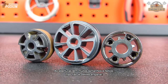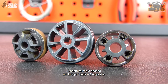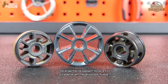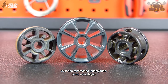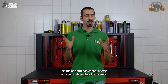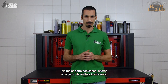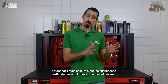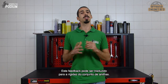The ports come in many shapes and sizes, but don't be fooled — a port isn't just a hole in which the oil flows. Engineers spend countless hours working on fluid dynamics to make sure the ports provide the best oil flow while reducing any unwanted phenomena such as cavitation. In most cases, changing the shimstack setup will provide the desired results. The most common feedback people hear about suspensions is that they are either too stiff or too soft, which can be translated to the stiffness of the shimstack.